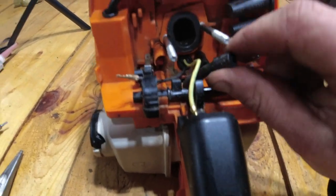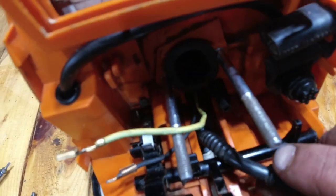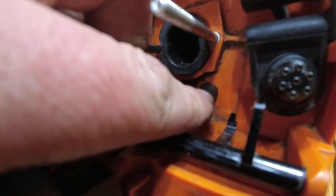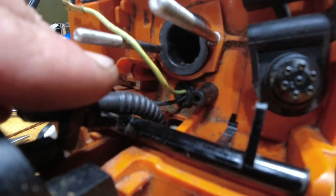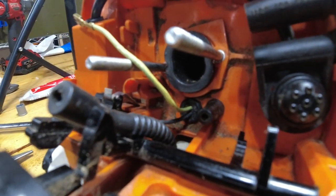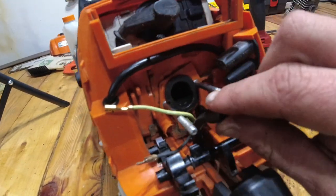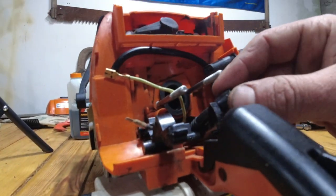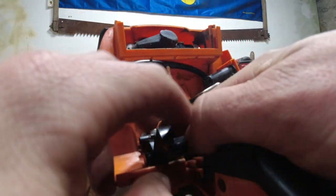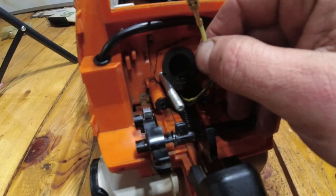But you have a fuel line coming up from the bottom through this center hole in the orange plastic there. Then you have your fuel line going to the motor that comes through the hole in the orange plastic, and that's the hole on the right. The electrical wires come through with that little rubber grommet, and that's the hole directly underneath the air intake, or the hole on the left. And this fuel line coming from the tank is going to get pushed up and back, and it kind of seats back in this little orange groove like so.